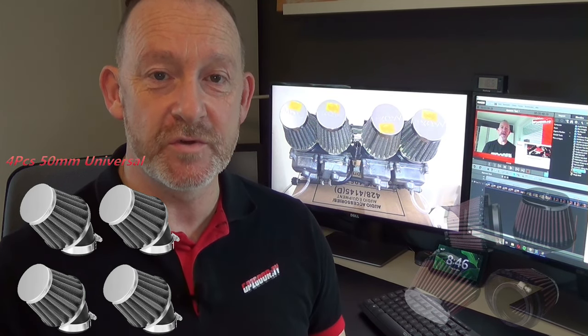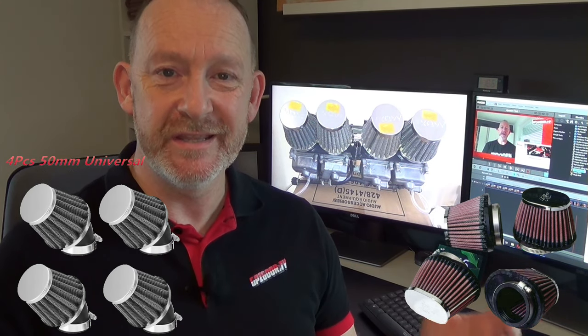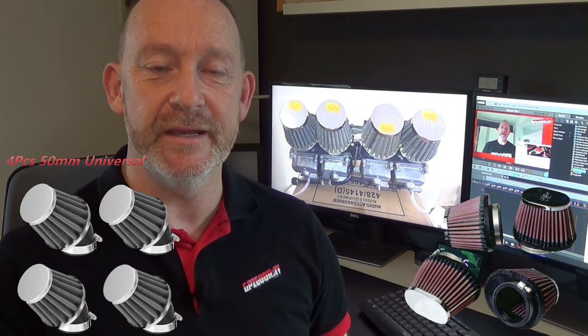The K&N ones will cost you 200 bucks. Not only is it a premium product, but they have a different shape as well — that's why the K&N ones are oval in shape. This is because you can't generally put four round ones together on the GPZ 600; they just don't fit physically, they're too close. I've got a few pictures here which I'll just pop up to show you what some people have done in an effort to try and get these pods to work.